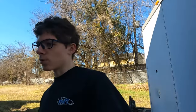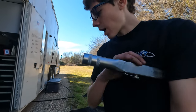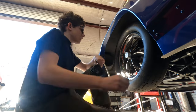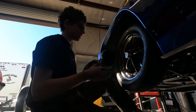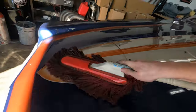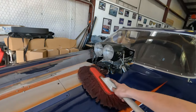Our entire goal tomorrow: racing doesn't start until two o'clock, so we want to be there and as ready to go as possible. We're trying to make two or three runs with my car and then one or maybe even two runs with Mr. Boston's altered. Right now I'm going through a bunch of little stuff that's got to get done before the car goes out — trying to get it done tonight rather than tomorrow at the racetrack, so the only thing we'll have to do when we get there is torque the rods. Next we're setting tire pressure in the front wheels — dad wants both cars set to 50 pounds.